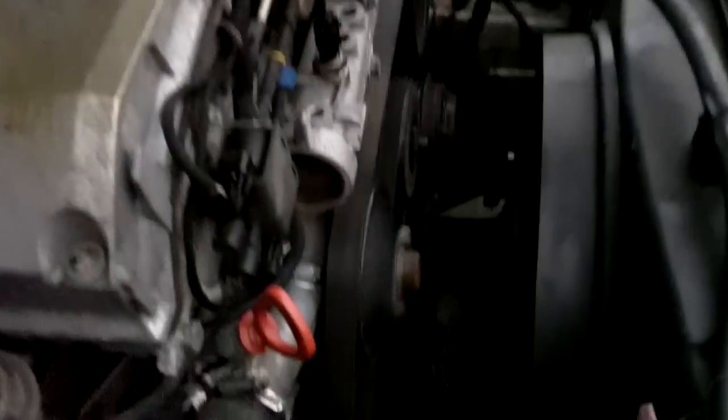You could look out and get it in really quick. I haven't completely finished tightening it up yet. Well, that's all that's left to do is tighten it up, but you have got to put the outer nut on first, the outer housing, then put the spring in with the inner little rubber bushing, and finally the end cap. It has to be done in that order according to the manual. So that's the way I did it. It's the first time I've actually consulted the manual for anything on this thing, but that's the way they say to do it, so that's the way I did it, and it is a bitch.